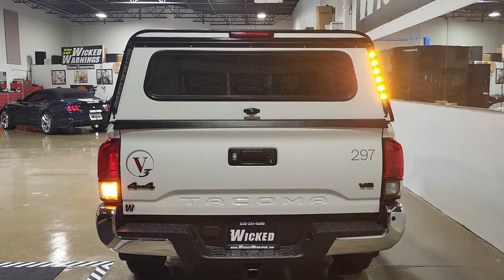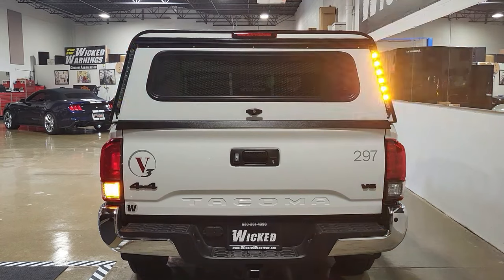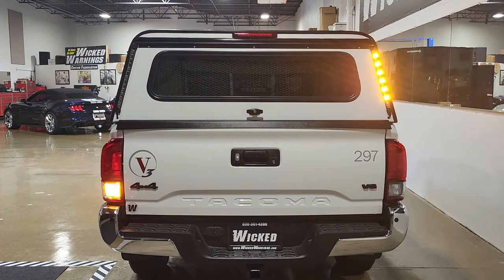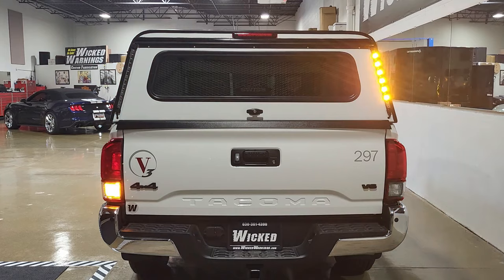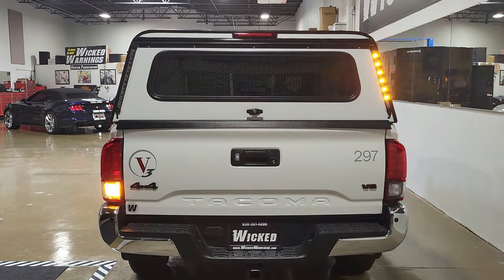Around the back of the vehicle we continued the theme of triple flash alternation in all amber, using our amber-white Thin-X strip. Don't let the name fool you — just because it's amber-white doesn't mean you have to use both colors. We manufacture it amber-white for convenience and price point. You can flash amber only, white only, or use steady white flood mode — all features are available.